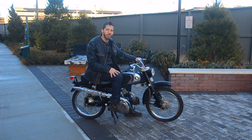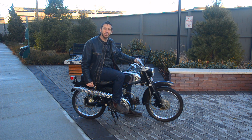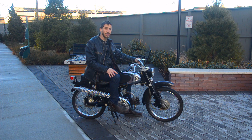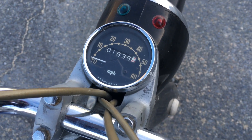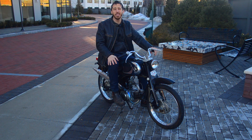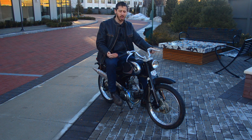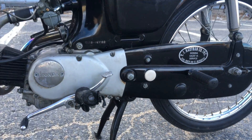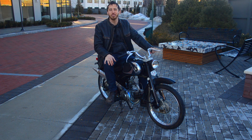I'll probably start with the motor, then move on to the battery. The swing arm isn't the proper size for a lot of hub motors out there, and I'm not sure how I'm going to get a torque arm on here, so I may need to do some slight modifications to the swing arm. There will also be some wiring issues and display decisions — right now the only meter is the speedometer, so I'll have to figure out if I want a battery display or if I'd rather keep the whole thing looking stock. The existing wiring is archaic and on a six volt system. Also, the foot pegs are mounted to the engine block, so when I remove the engine I'll lose the foot pegs and will need to figure out a new mounting solution — probably combined with the battery mounting since they're all in the same area.